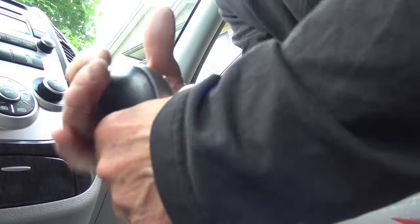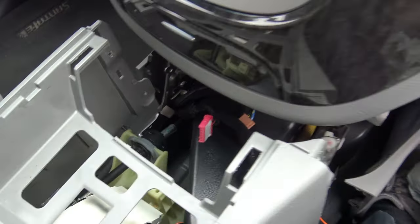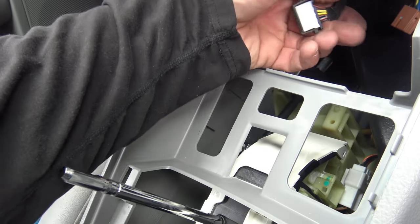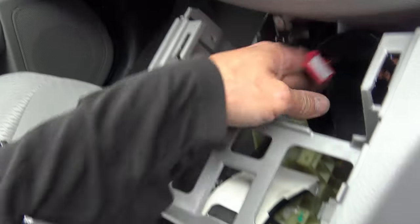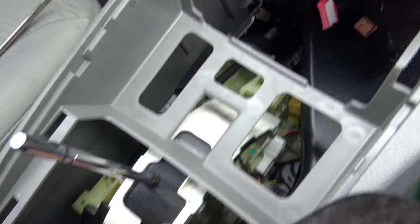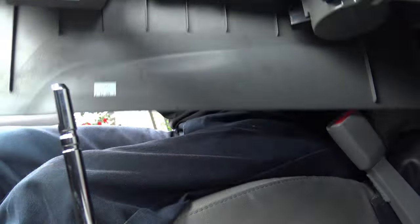We're in neutral — pull straight up. I hit myself in the face. There were clips to deal with: press down on the sides for one clip, then another clip, press both sides at the same time. Another clip — push down the tab in center. One, two, three. And then there's a tough tab where you've got to get the plate off a little bit so you can reach in and push the tab down. And there we go.